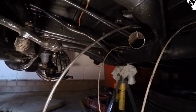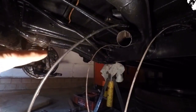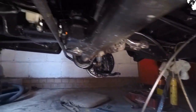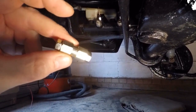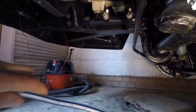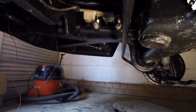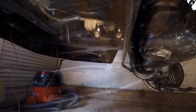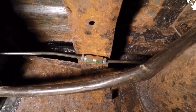What's happening up underneath the front and the rear of the bus is that the brake line that passes through the conduit from front to rear is not long enough to go directly to the master cylinder. So what I'm going to have to do, both front and rear, is connect a piece of pipe on just to get that additional length. At the rear I've been able to use my flexi ruler to pass through the chassis rails and measure the correct length of pipe that needs to go in. That's the connector for the rear and I'll put some sort of saddle clamp in the middle of that to secure it.